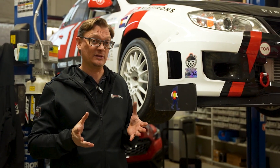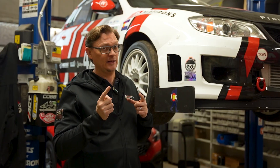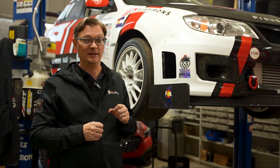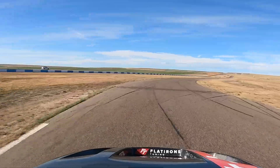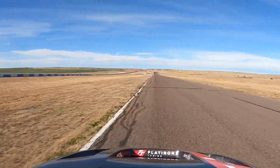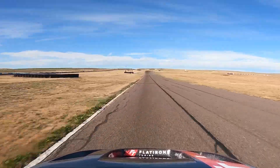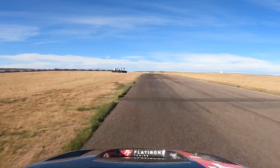The brakes were really inconsistent for the rest of the day. Now that we've got the car back on the lift and given it a look over, it turns out it's not as much to do with the brakes as you might think. If you've gone out to the track with NASA or the SCCA, on top of almost all these tracks' safety check lists are wheel bearings — because wheel bearing issues can be a problem in themselves, but they can actually lead to other issues you might not think about, like brakes. And that was our case.